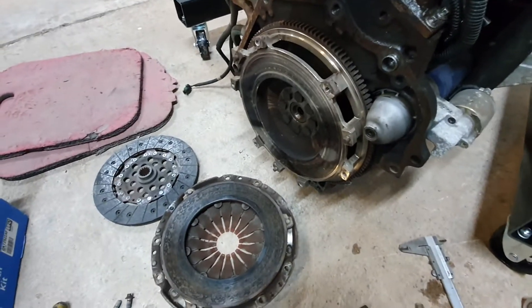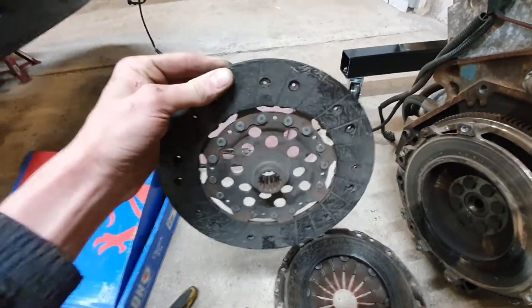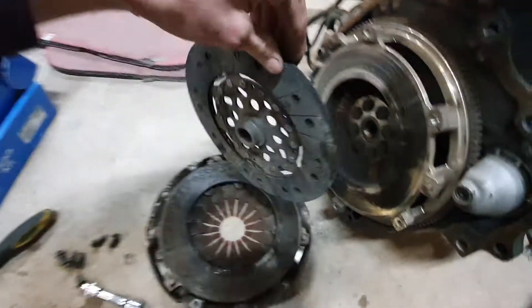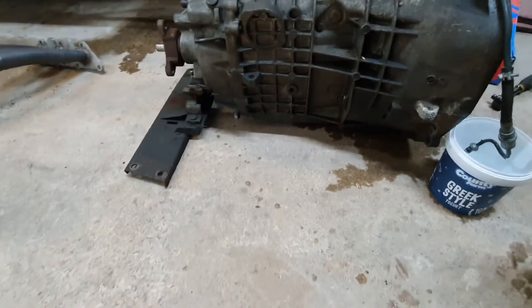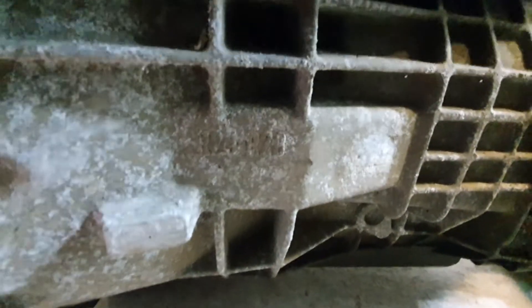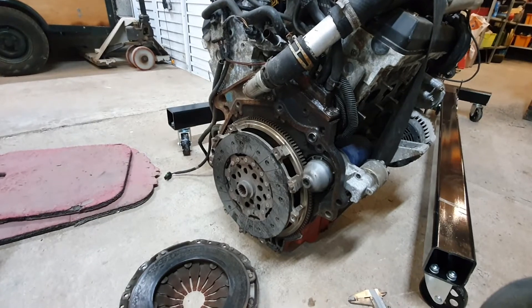We drove the Omega quite a bit, me and my brother, before I took the engine out to put it in the Scimitar. So this is a fantastic piece, but of course a dual mass flywheel has springs in it, so it does not require springs in the clutch. This is a 240mm clutch that comes with the dual mass flywheel — obviously it fits on here and this is the correct part for it. But we now have no springs in the driveline. We've got a gearbox that's rated for, I believe, around 280Nm — the R25 or R28 or something. The engine on the dyno we figured was now producing 350Nm, so it's already marginal at best.